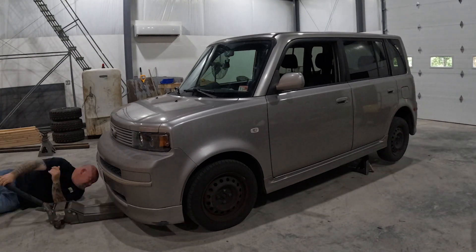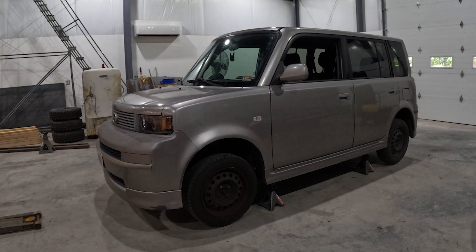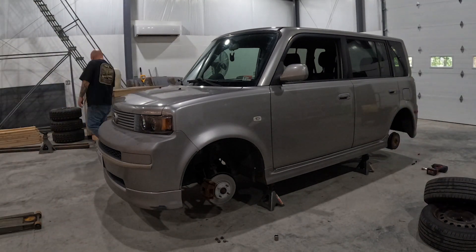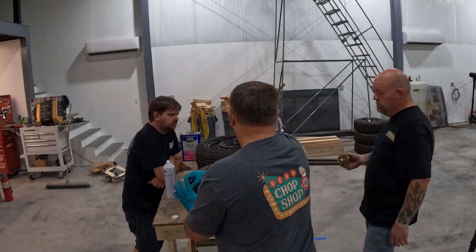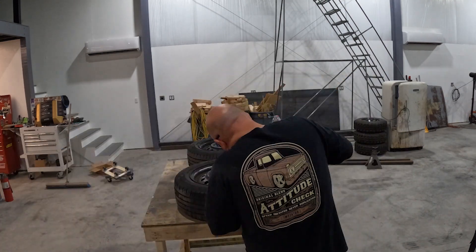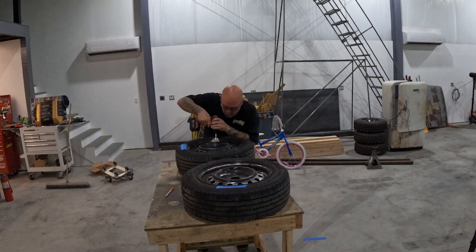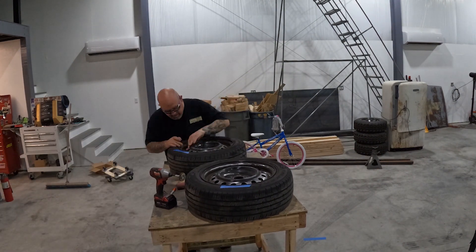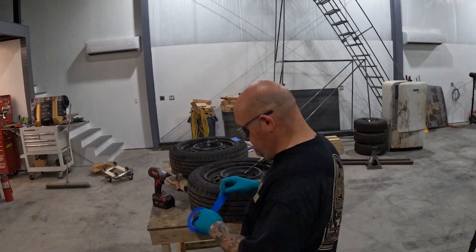While I'm working on cleaning up the garage, I got Kyle taking the wheels off of his car and then I have him start wire wheeling and sanding the rust and trash off of them. We cleaned them with some MEK substitute and wiped them down since he didn't wash the wheels before he brought the car over. Then he started wire wheeling them and sanding all the rough spots. We pulled the wheel weights off, taped the location where they were, and marked it so we could put them back in the same spot.